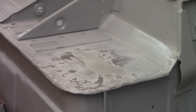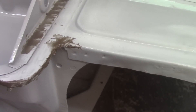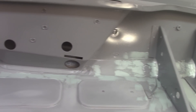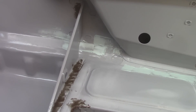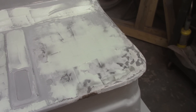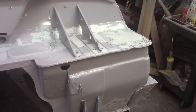Now I'm going to go around one more time and hit all the spots where I want to put filler in for the pitting with 180 grit, just to scuff it up and make sure it's all good. Then get the regular filler on the pits and fiberglass on the weld repairs that were bubbled. Got the filler down — fiberglass filler here to try to make that corner round out a little bit to match the other side. You can see a little blob there that's a braze — I didn't braze anything, so I'll sand that out. A little awkward getting into the nooks and crannies behind the dash supports, but another pitch for the real thin one-inch wide flexible metal putty knife — never would have been able to do that with plastic. I'm going to call it a night because I have to go home and make meatloaf for dinner tomorrow.